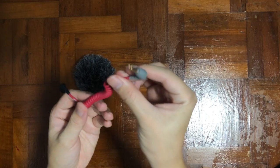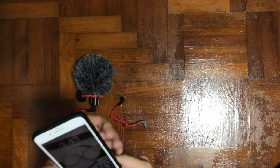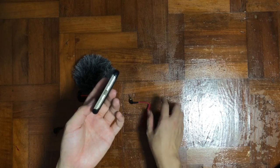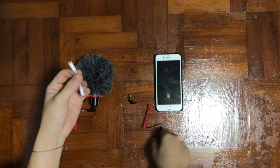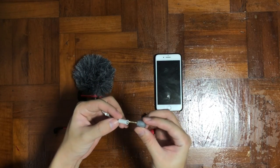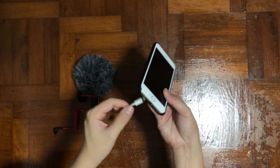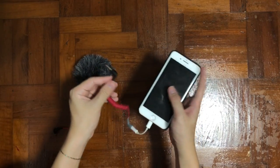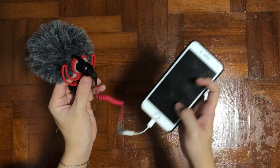I'll show you a sample of how to set it up. I have my iPhone 7 here, but since the iPhone 7 has no headphone jack, you need the Apple Lightning to 3.5mm headphone jack adapter from the Apple Store. Plug the TRRS gray side into the 3.5mm adapter, and plug the Lightning end into your phone. After that, take your microphone and plug it into the other end — and that's it, you're set up and ready to record.